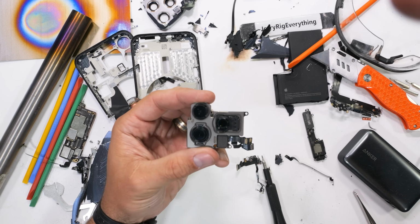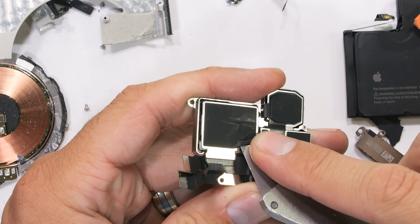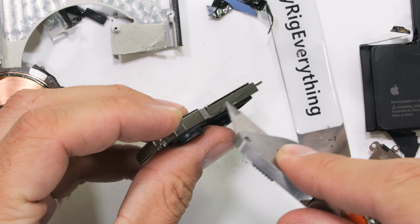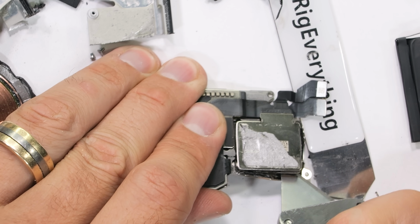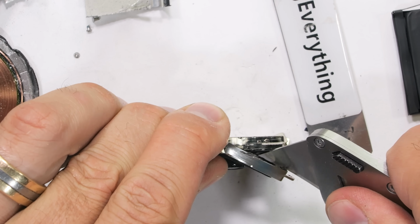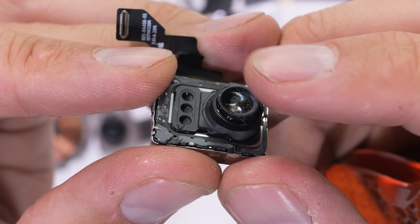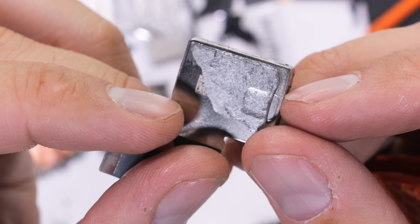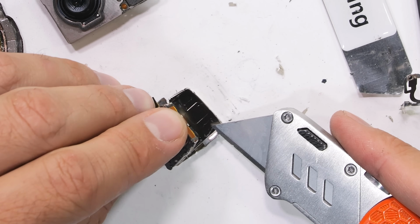Speaking of something new, let's spend our last few minutes together finding the 5X Tetra-Prism. None of the camera units have external optical image stabilization. Apple's using sensor shift stabilization on both the main camera and the Tetra-Prism. I don't care about the other cameras though, I mostly just want to see how this 120mm focal length equivalent gets its light rays reflected 4 times inside a glass structure. The cameras are all situated in one solid metal housing, so they can transition seamlessly between themselves without one of them being squampus.